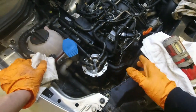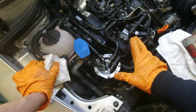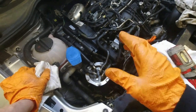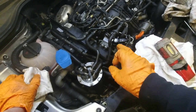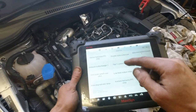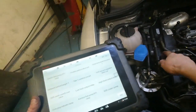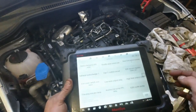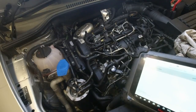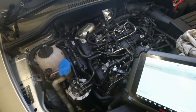I'm going to use the scan tool. It's absolutely essential on this particular car — if you just turn the ignition on it will not run the fuel pump, and you'll end up cranking and cranking with the high-pressure pump turning dry, which you don't want. The scan tool gives two options: auxiliary fuel pump relay and electric fuel pump relay. The one in the tank runs first and fills the canister — you can hear a bit of gurgling there.